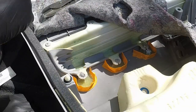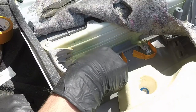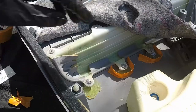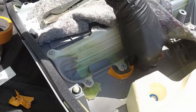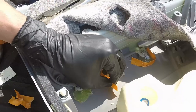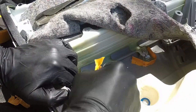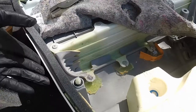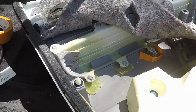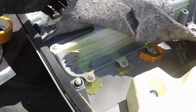Once you have all the epoxy in there and everything's cured up, you can either leave the tape or remove it either way. Some of it may not come out if it's too stuck under the epoxy. Make sure you do let it fully cure before you do this. And then to stick the felt back down, you can use little drops of epoxy or you can use super glue.